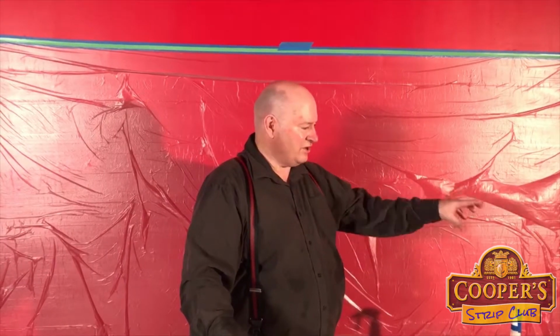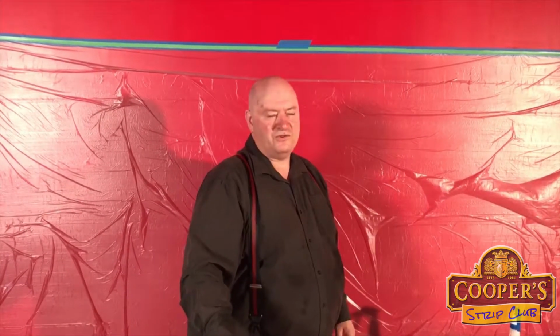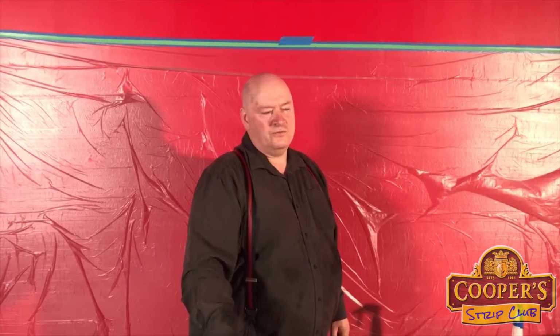Talked before about the submersion, but also there's no water in this, so you're not causing any corrosion. So that's a big advantage. Everything on that bonnet is, we're not creating anything new in the corrosion game. All paints, as I've said, doesn't matter what the paint is. In 35 years we've been doing this, we've yet to find something that won't strip. Some things take longer than others. It's just finding out how long it needs.